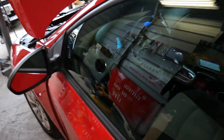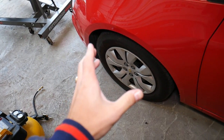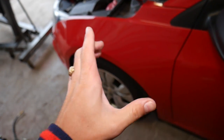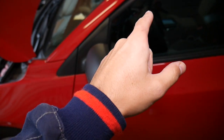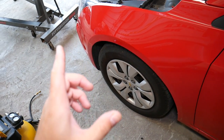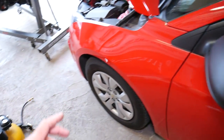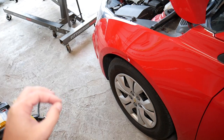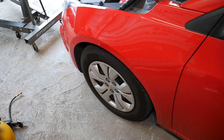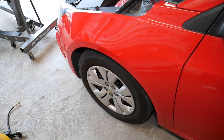That's how you find out which sensor is the correct faulty one. If it says rear right, deflate that tire and see if something changes on screen. If it doesn't change, keep deflating each tire one at a time and check the screen again until something changes. You can figure out which tire is where, make a diagram, and know which sensor to replace. Hopefully the video was helpful. Thank you for watching, please subscribe for more videos, and see you guys next time.